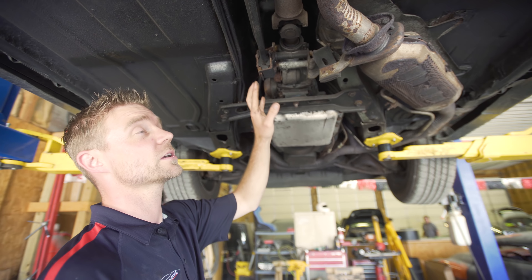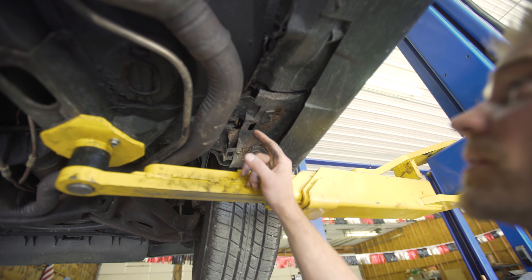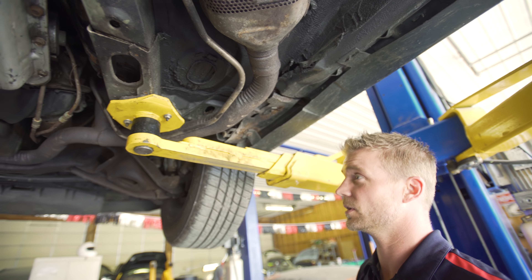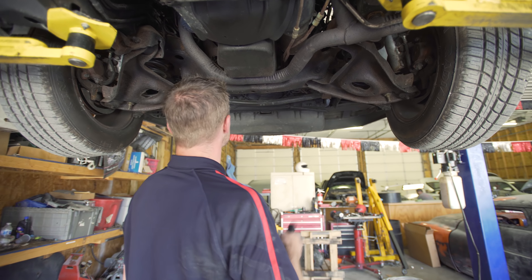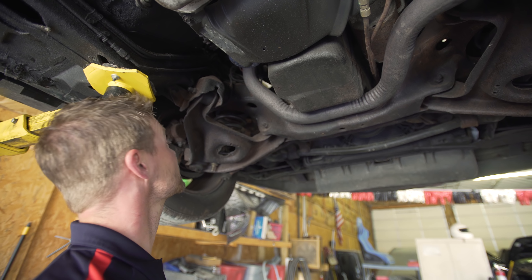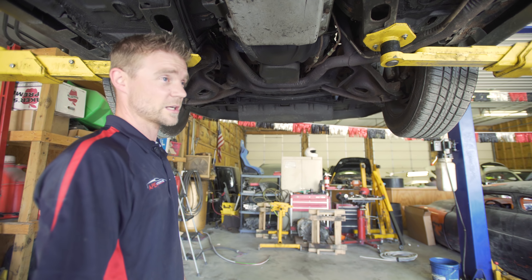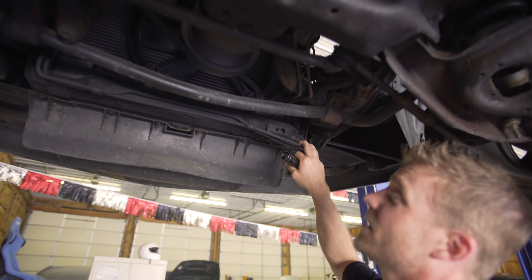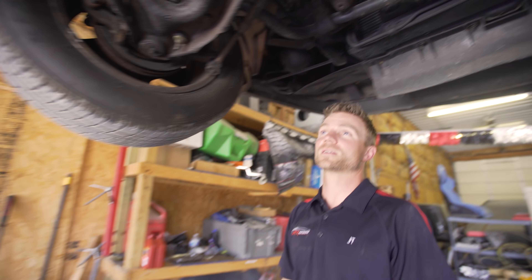A normal person would look at a lot of this and think it's super rusted, but it's really not. This is what I was talking about — lifting in the right place. Somebody lifted in the wrong place here, probably with a single jack, and crushed this pinch weld. Still not gonna affect the integrity of the vehicle in any way — you should just lift it properly. No major leaks underneath. A little seepage back here, probably the rear main or back of the pan seal — we'd suggest not even addressing that until it becomes a real leak. We're not trying to make a brand new car here, just a car that goes A to B and does it well. Good brakes, brand new brakes, brand new tires. They definitely went crazy with the underbody protection, but that's all good.